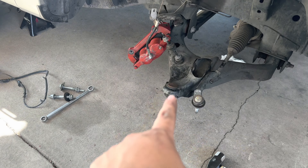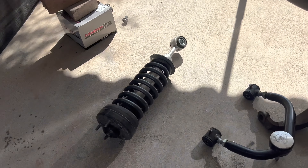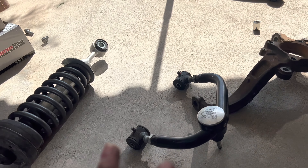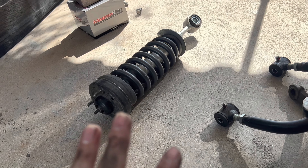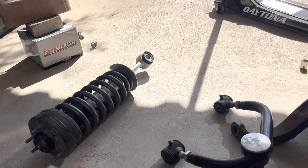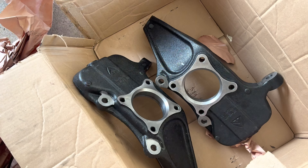Once I get the raised cross member, we'll lower it even more. Low-key I struggled getting the bottom ball joints out, but as you can see everything's out — the IHC control arms, the stock spindle, and the hubs. Here's the strut and the springs. CTP told me to adjust to about one-half to three-quarters. Since the spindles are two-inch, I think I'm gonna keep the three-inch springs and just add spacers to the strut, adjusting it to stock height using the spacers they give you.